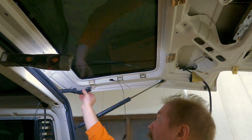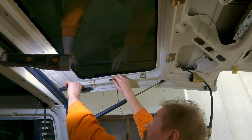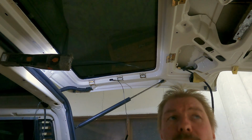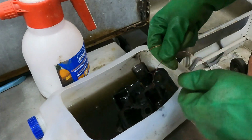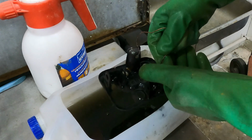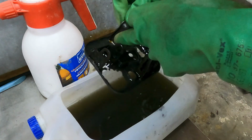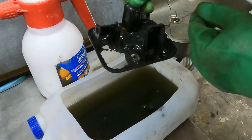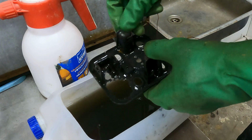Okay, now we have cable here, and we have to roll the old torsion of the cables off and then put this rubber back into place, and then route all these plugs. Yeah, now I use the hot phosphoric acid, about 80 degrees. So this is almost 100% now. I see a little bit there in a corner, but I need to weld this anyway and repair this, and then I need to clean it again a little bit. So now this is okay.